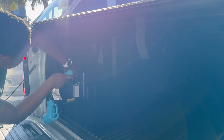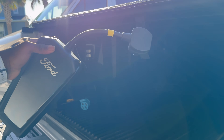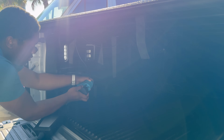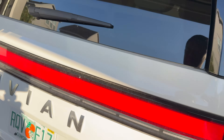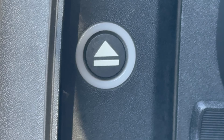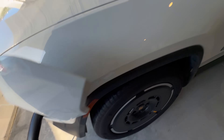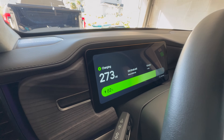ProPower is super useful. I'm going to open it up — there we go, I opened the wrong one. This is the correct one. Plug that in like so. There you go — now that's in. We'll take our EVSE and plug it in right here. There we go — it's got power. Let me untie these and we'll walk over to the Rivian. ProPower connected. And we're going to now plug it in to the Rivian. There we go. Outlet is running, EVSE is working, and Rivian is charging. Pretty good.